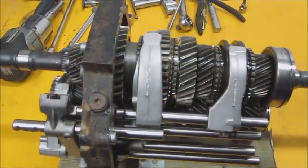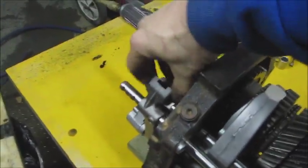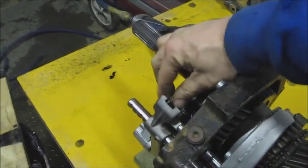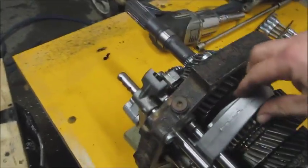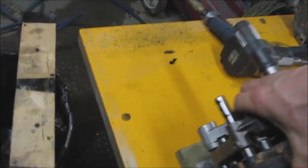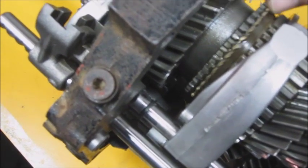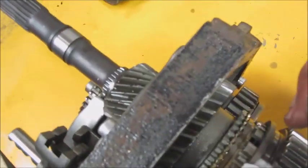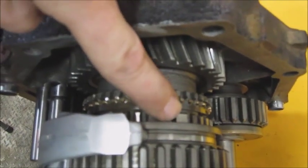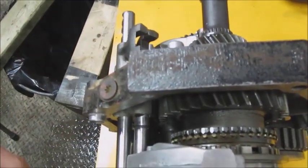So in a nutshell, that's how you pull the cover off the transmission and do a visual inspection. If you can, don't be afraid to move these things back and forth — you can see moving the middle one puts it into fourth gear, pulling it ahead goes into third. The lower one should be first gear, but it wasn't moving for me, which is probably part of my issue. Once I got it moving, I can see all kinds of damaged brass in here, gouges in the brass, and there's a hole where one of those keys is supposed to go. The key is actually broken right out of this synchromesh unit between first and second gear — so this transmission is going to need a rebuild.